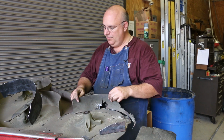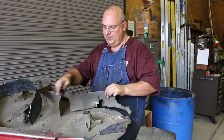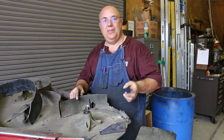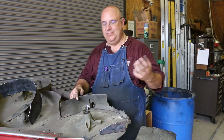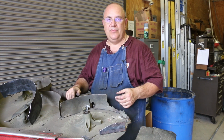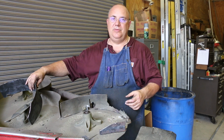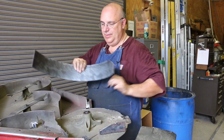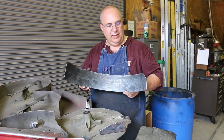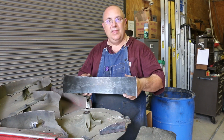And I said, well, I'm going to go with something that's a little bit thicker when I replace this. So I actually got some 1/8 inch thick. And it was about 27 inches long. And of course, it was rolled into an angle. So I went by Tifton Machine Works, local machine shop here in town. They're real good about, if I ever need a short piece of metal or whatever, they'll cut me off a piece and sell it to me if they got it. Well, they actually just went and using their shear, went out and cut some plate material, and they sheared me a new piece out. And as long as they had it, they went ahead and ran it through the rollers and kind of got it to the approximate diameter that we needed. Using the old one as an example, and I can fine tune this.